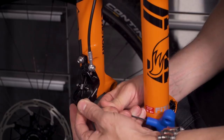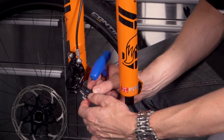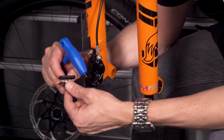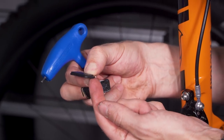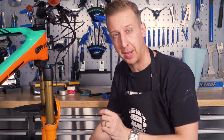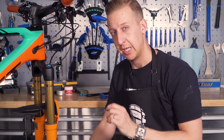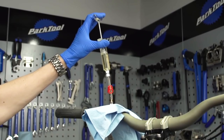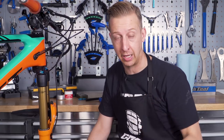Now it's just a case of removing those brake pads and inspecting them to make sure there's plenty of life left on them. Depending on the manufacturer of your brakes, they remove in slightly different ways, but they all tend to have a retaining bolt and a spring washer between the pads. There's plenty of life left on these — what you're looking for is plenty of pad material in relation to the backing plate. If your brake pads are in bad condition, replace them at this stage. If your brake pads are fine but the lever is still pulling all the way to the bars, you're going to need to bleed those brakes. There's a link in the description below for how to bleed these SRAM Guide brakes with the bleeding edge port, and also links for Shimano and other Avid or SRAM brakes.